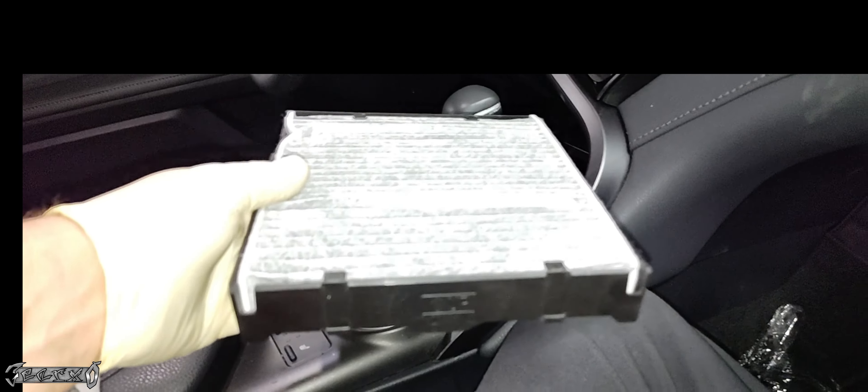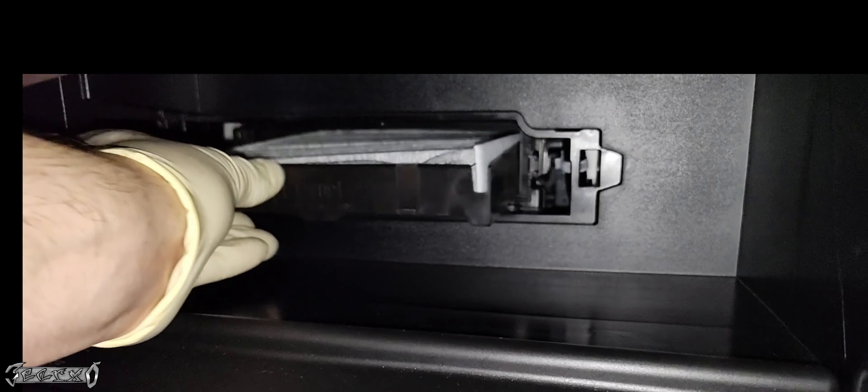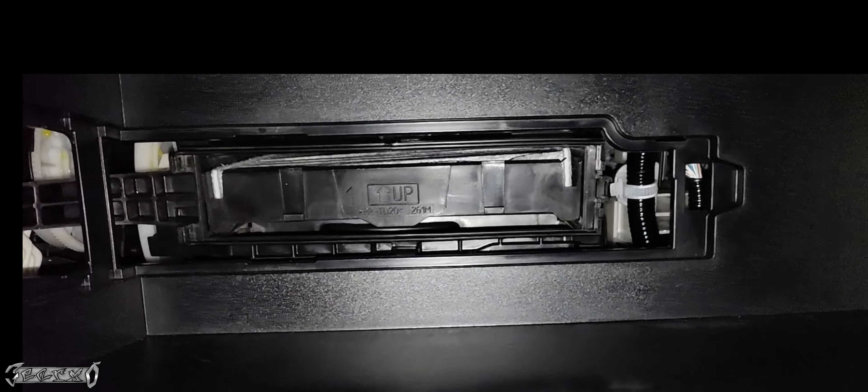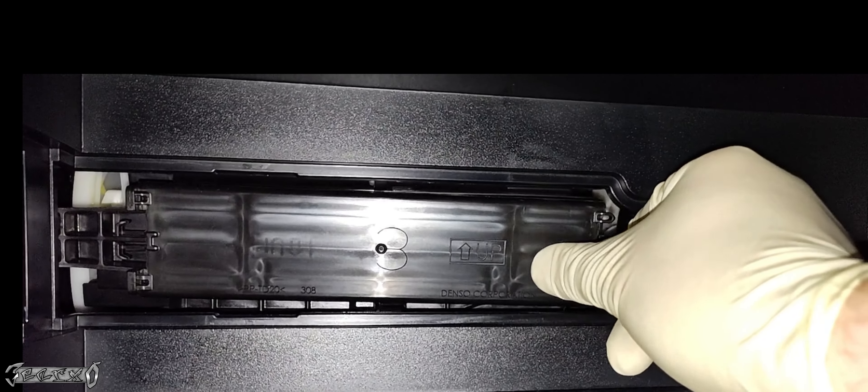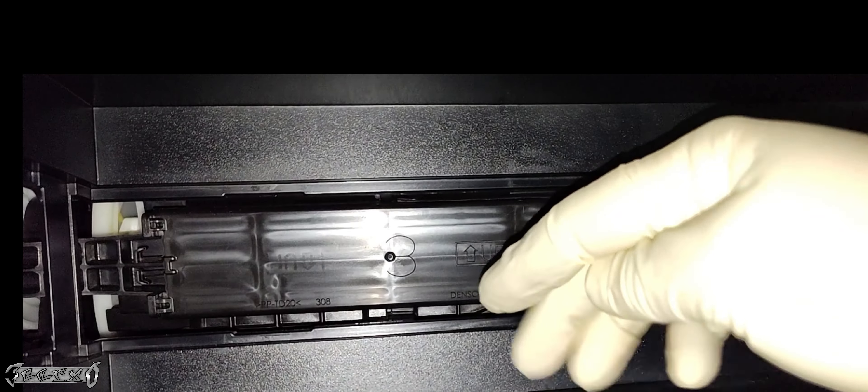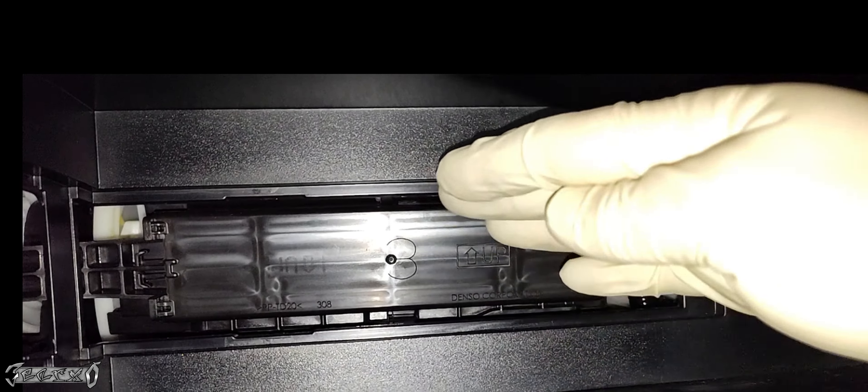Get the filter in your tray and slide the tray back in. Most of the time it goes in fine, but sometimes it won't seat correctly. If you're having issues, take it out and put it back in. When you put the access door back on, it has little spikes that push the tray upward — but sometimes it doesn't work, so just remove and reinstall the tray. Put the left side of the access door in first, then slide the right side into place. It should click, with the arrow pointing up.